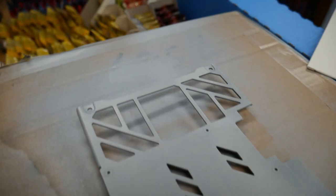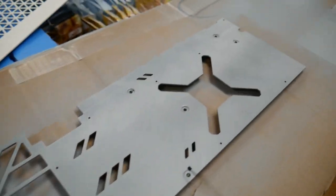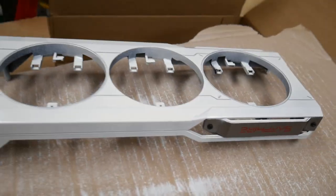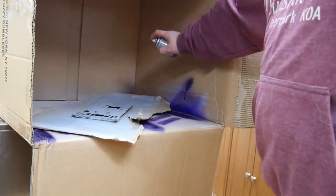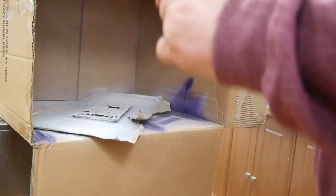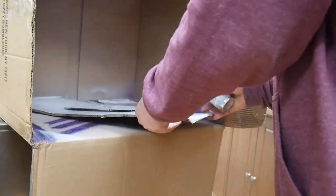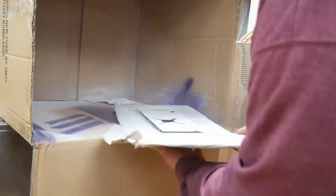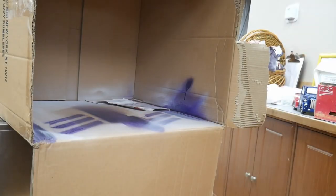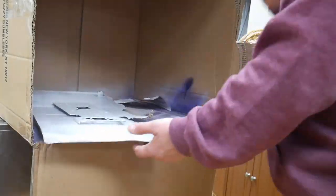This is the first coat of paint on the fans, and here is the first — and only — coat of primer on the backplate. We'll come back two hours later. Here is the fan shroud again with the tape off the Radeon spot. We're putting the first coat of white enamel paint on the backplate. This piece gets hot and it's metal, so make sure you use enamel — anything else is not going to last.